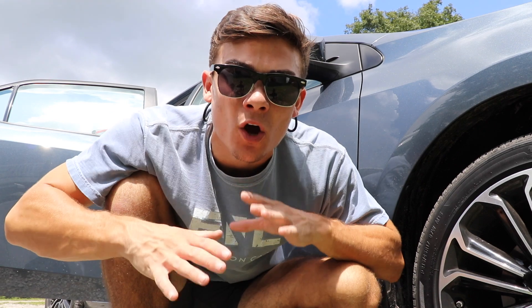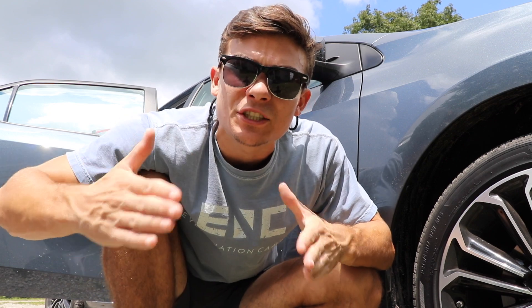So if you're just beginning in the auto detailing business, you might be wondering: why would I want to intentionally remove the wax from the painted car surface? The answer can vary, but I would say probably the main reason that most detailers actually remove wax — or remove a sealant intentionally — is because they're about to polish a car.